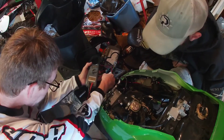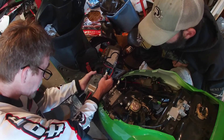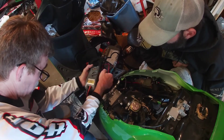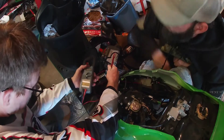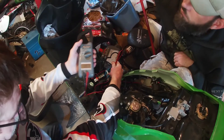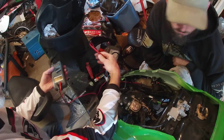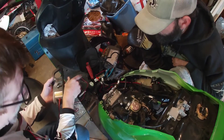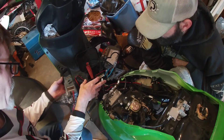Let's make sure that's the right wire — yes it is, 100%. We'll try one more time. I see no trigger on there. We should have had about two volts on this, so it appears we don't have a trigger signal.